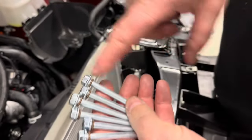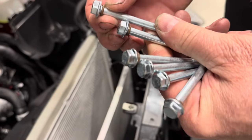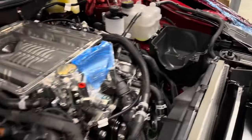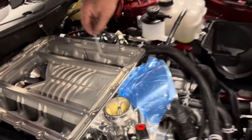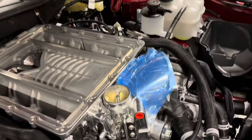These six internal bolts have O-rings that you have to put on, so make sure the O-rings are in and you lube them. Those go inside the blower. You've also got four corner bolts on the outside holding the blower down — so six bolts inside and four bolts outside total.